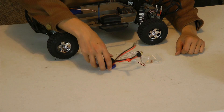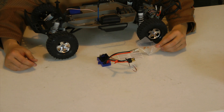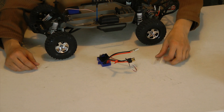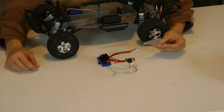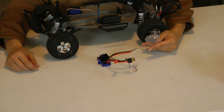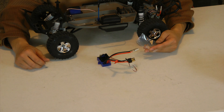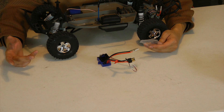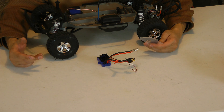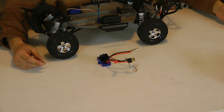What you see in front of me is just the ESC, filter capacitors, and the EZ Set tips card — the important parts that came out of the packaging. The filter capacitors we won't be needing in this install, just because we're putting it back with the stock motor that came with the truck. However, if you're putting this on a new motor that doesn't have the caps, you're going to want to install these. This is for brushed motors; with brushless you don't have to worry about it.